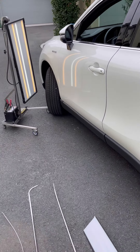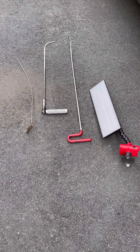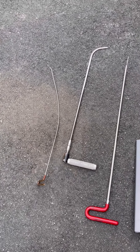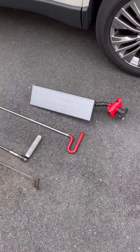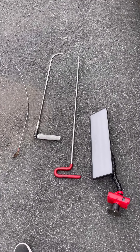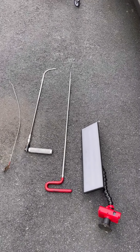Tools used: we used the R14 by Dent Magic, Dent Reaper, and just an old-school 3/16th 45-degree bend to get into that braced area. You guys saw the crease killer and dead center crease tabs that I used to get the meat out on that.